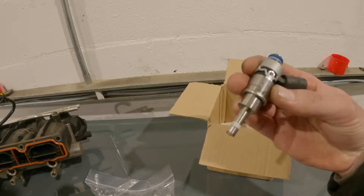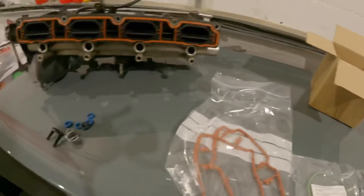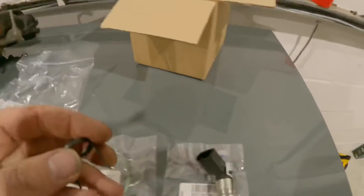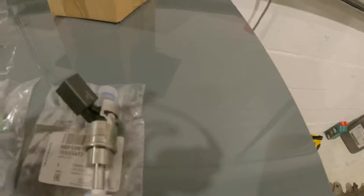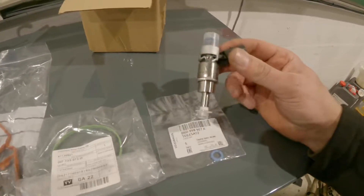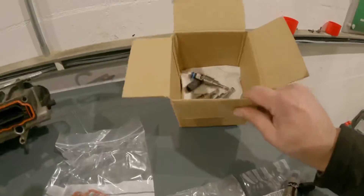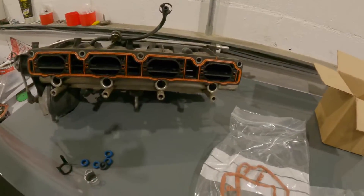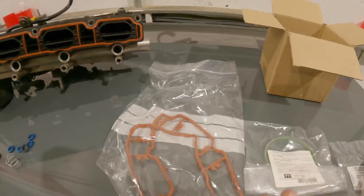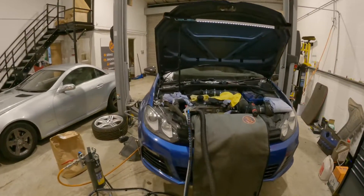I've had the other three injectors all cleaned and I've put new seals on them - new Teflon seals. You get a little repair kit from Volkswagen and they have modified them slightly. When we removed the old injector you could see all the plastic retaining clamps were cracked - cracked on all four. You can get a repair kit for the injectors with new seals, Teflon seals, and clamps - so they're all changed. There's a new intake manifold gasket there too, and all the gaskets we need.